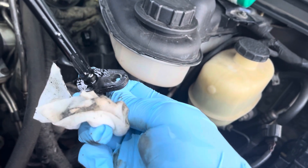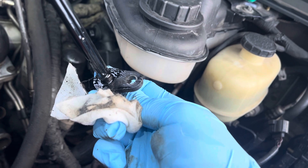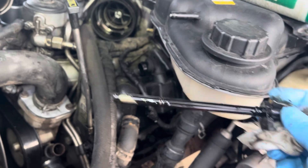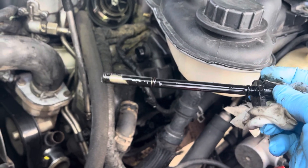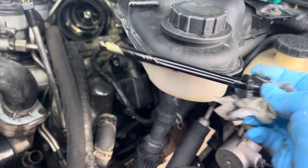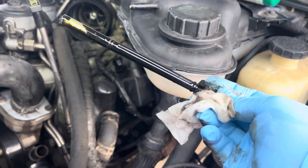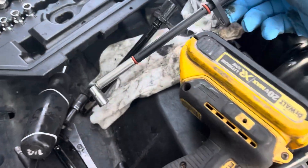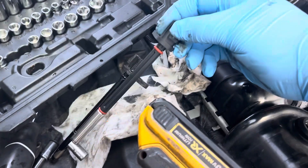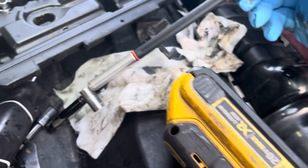What's likely going on is liquid getting into the wire and not actually the sensor itself. But you can see this buildup here — it means the mating surface has created some distance from the camshaft to the cam shaft sensor, which can also cause it to shut off. Since we already have it out, we're going to put the new one in anyway. Let's check magnetic polarity — it's obviously working because it picked up my socket.